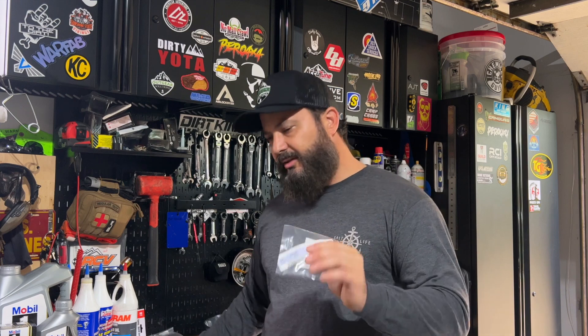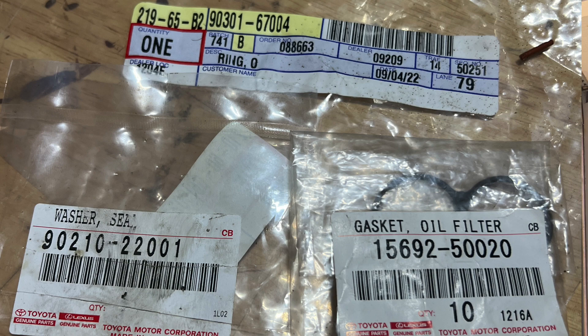We're going to change three of the gaskets or washer seals inside of that oil filter adapter. We have to get down there and take it off. I'm going to clamp off the coolant line so we don't lose too much coolant — there are two coolant lines that go into this adapter. I have all the parts here, all the gaskets and seals from Toyota — I'll put a link down below. This isn't super common, but once you get past 200,000 miles the gaskets go bad and leak. Once I get out of the car I can just smell the oil, which is what got me looking at everything.